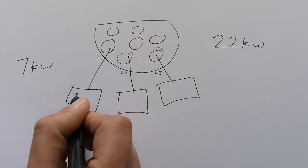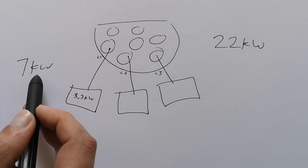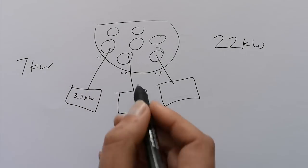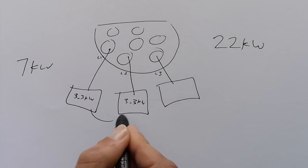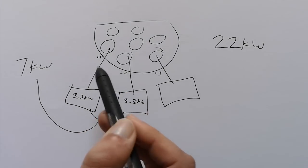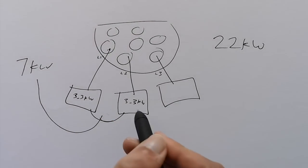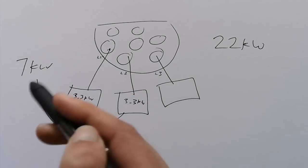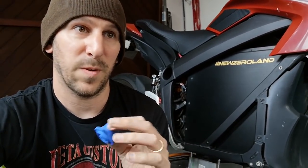When you go to a single-phase station, those are only seven kilowatts and they only use one phase, so they only use one charger and that's 3.3 kilowatts. It seems kind of a waste because you have a seven kilowatt station and you're only using 3.3 kilowatts. You could potentially be using two DigiNow superchargers combined on one single-phase station. But since you wired them up by phase, that single-phase station can only use one charger. So the best way to do it is to keep them separate and link them together depending on which station you're at, basically ensuring that out on the road you can always use at least two chargers, maximizing speed.